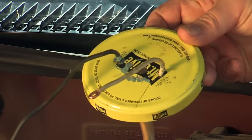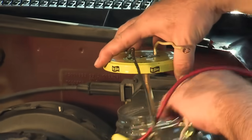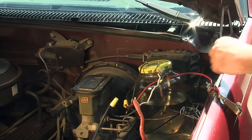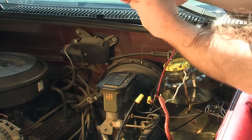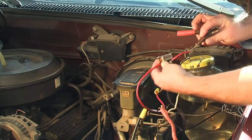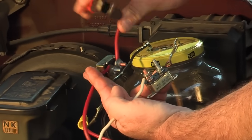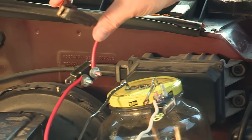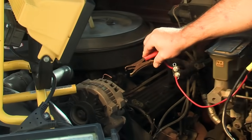You run the wires through the lid like this. I'm going to install this down here, seal it up, and show you how this thing produces gas. This is the positive wire which I run to the alternator. Here I've installed a 30 amp auto reset fuse on both sides — positive and negative — so I have redundant fuse protection in case of current overload, since the fuel cell will occasionally pull too much power. We want it to automatically shut off.